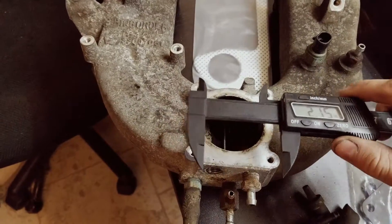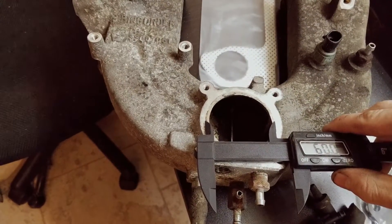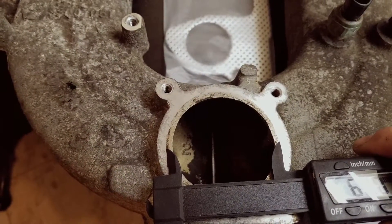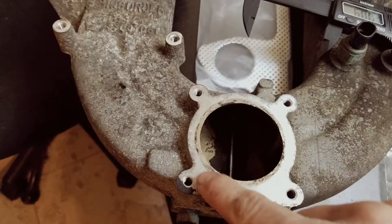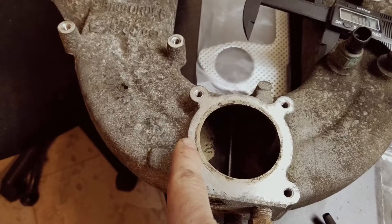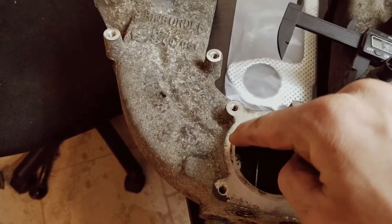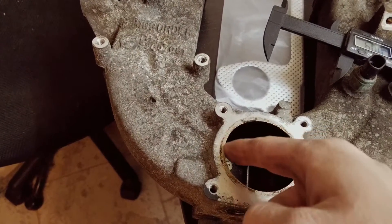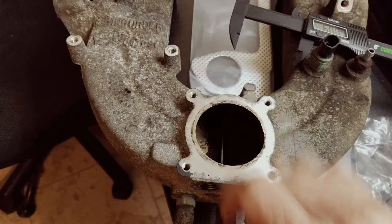What you'll experience — and we'll go back to that 60 real quick — is you can kind of see there's a ring of grime on here from where the gasket was sitting before, because the gasket is a little bit larger. This ring of grime is where the 4 liter throttle body is going to sit, so the air is going to come down and hit this wall. It's going to get all kinds of turbulent, and then it's going to go in. So by removing this material, we're going to eliminate that turbulence. That is why we're going to bore this thing.